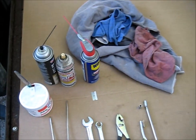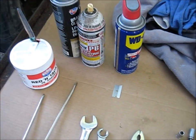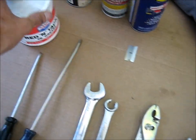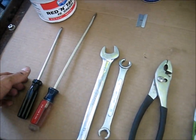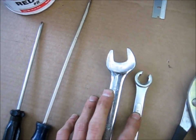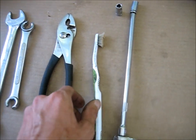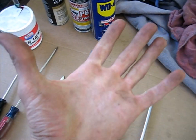Alright, so here's what you're going to need if you want to do this job. You're going to need some rags or grip towels, WD-40, PB Blaster, some lubricant of some sort, cleaner, some grease. Phillips and flat screwdrivers, 14 and 19 millimeter flare wrenches preferably, something to cut hose with, some pliers, something to clean with, 7 and 8 millimeter sockets. And you need two of these.